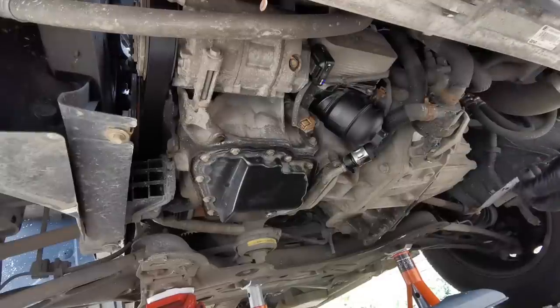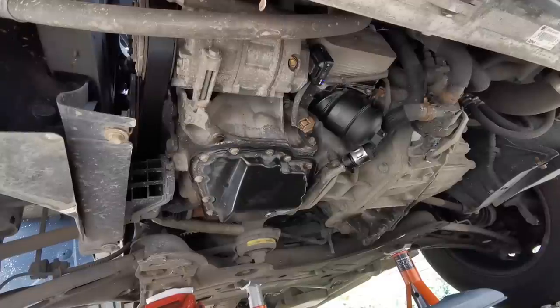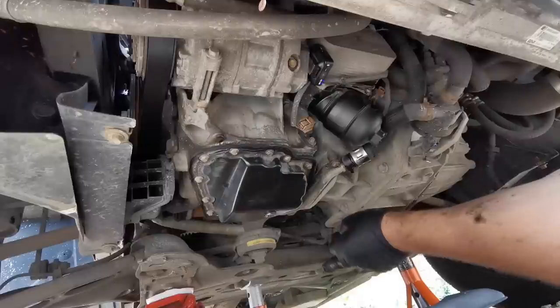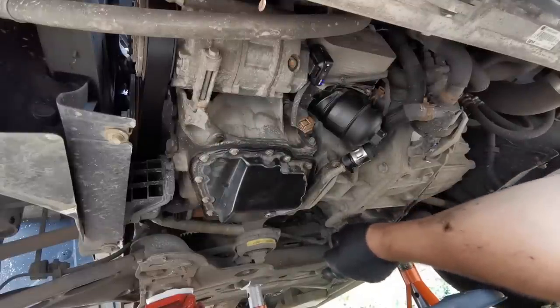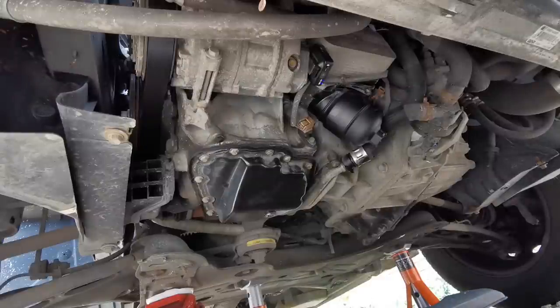You can see where I've been - all lovely and clean. The engine is dry underneath as well, which is a good sign. I have noticed there was a little bit of misting on that front shock absorber - you can see it's a bit wet so that'll be a job coming up. All the drive shafts and CV boots are bone dry though, so just a bit of misting on that shock. We do still need to do the fuel filter - I believe it's just behind the passenger side there, just to the right of that axle stand. That won't be in today's video, I'll bring that to you later.